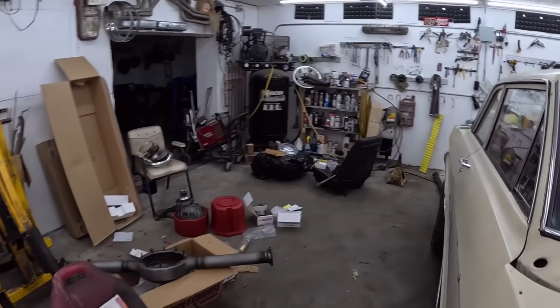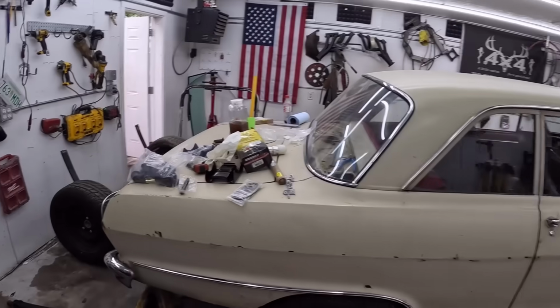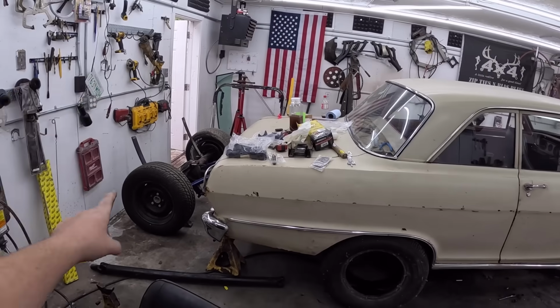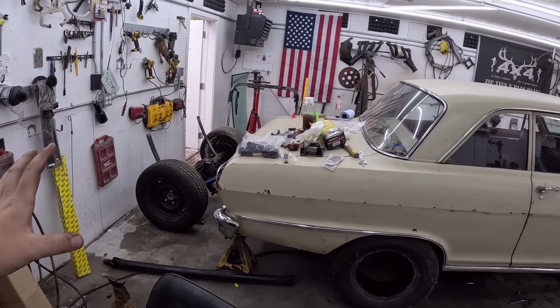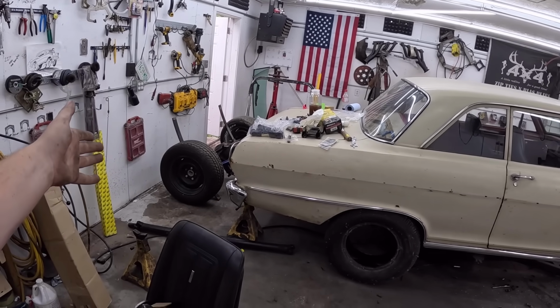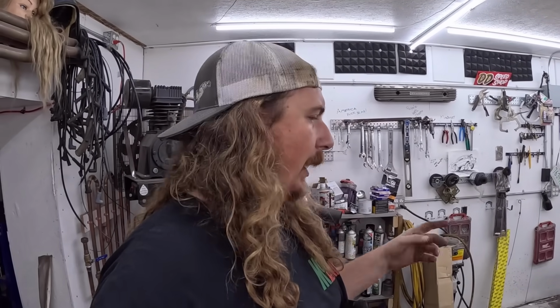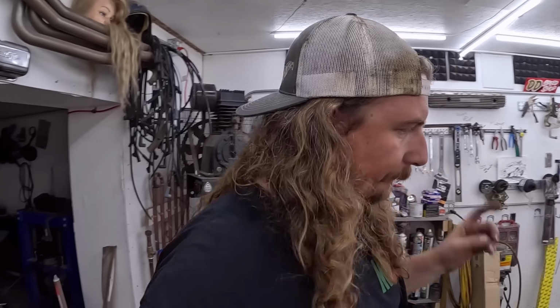Now, unfortunately, or fortunately, we're changing the rear end in this thing. I had it a little far back, and it's just driving me nuts where it is, but that'll be a great Tri-5 rear end. They're 58 wide, drum to drum, on these little Chevy 2s. Tri-5s are 60, so you get an inch on each side. A little 10 bolt if you want to put something together. Anyway,